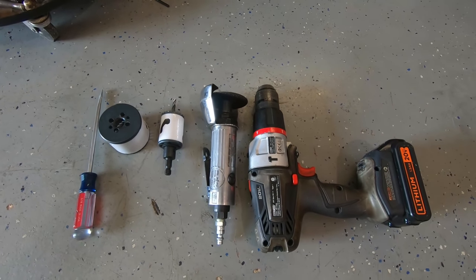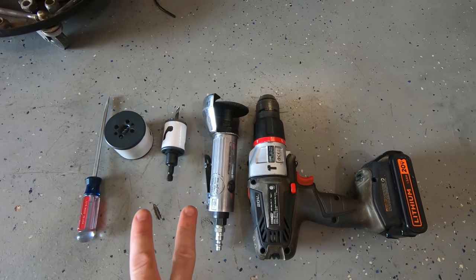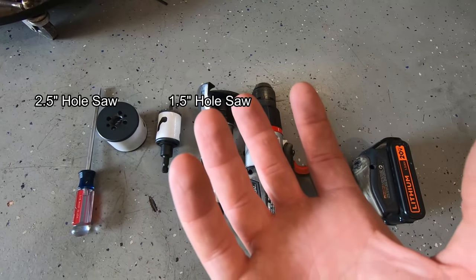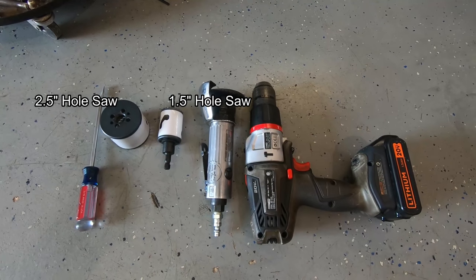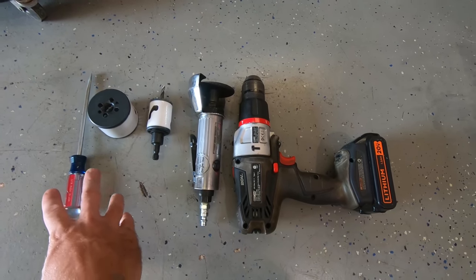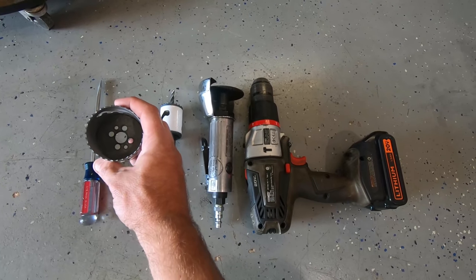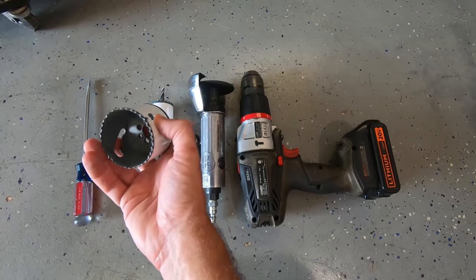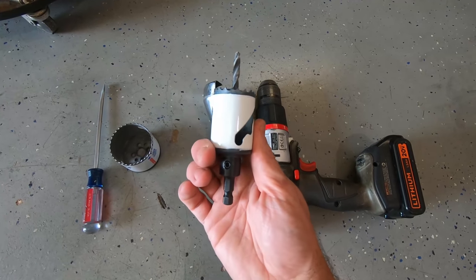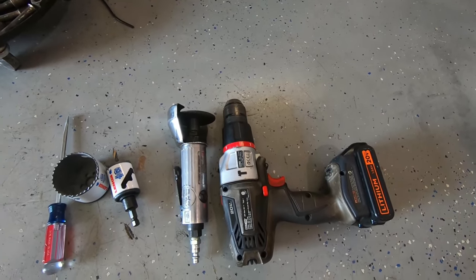The tools you need really depend on what kind of hood you have. In my case I have a fiberglass hood, and because it's two-layer and very thick, I need two hole saws. We have to drill a hole larger than the ring on the bottom layer of the fiberglass hood. You'll need a screwdriver to help pry off the bump stop clips, a two-and-a-half inch hole saw (for fiberglass), and no matter what hood you have — steel or fiberglass — a one-and-a-half inch hole saw, a cutoff wheel, and a drill.